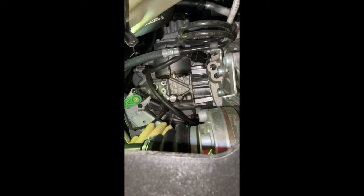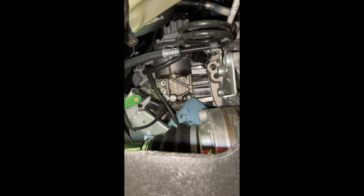You'll feel it disconnect — just be careful towards the end so you don't dump it on yourself. Slowly slide it down. The filter came off inside — sometimes this can happen. Just put your finger up in there and pull it down, then dump it right into your bucket or pan. That's why we have the rag there. Go grab another paper towel, clean the frame rail off if you spilled any, and catch the drips while you go get the new oil filter.